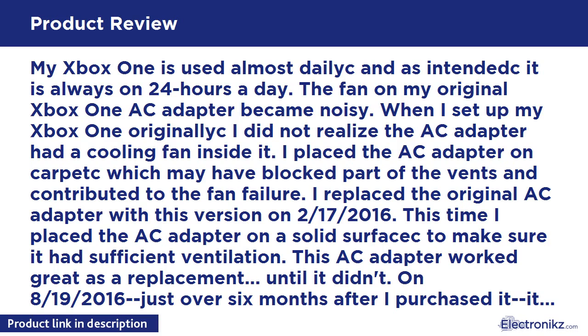I initially thought the game itself was crashing my Xbox One or that there could be an issue with my external hard drive. I made several configuration changes: first deleting and reinstalling the game, then reinstalling the game on the internal hard drive. Regardless of the setup, when I began playing, my Xbox One would hard shut down. After this occurred perhaps 6 times, when I attempted to turn it back on it would only stay on for about 2 seconds before turning itself back off.